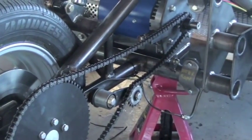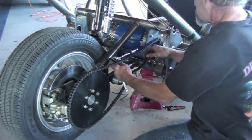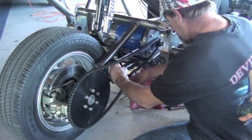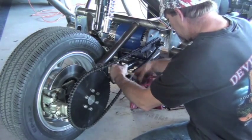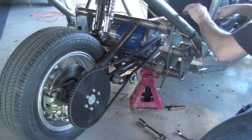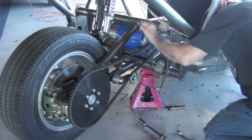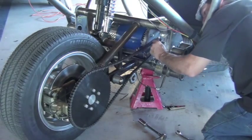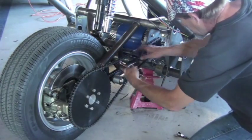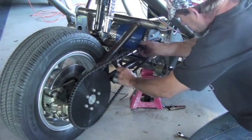We have our chain lined up correctly and our subassembly attached to the swing arm. Now we need to adjust the tension of the chain. We do this with a tensioner bolt near the motor — it pushes the motor forward away from the drive sprocket and puts tension into the chain. If you've tightened the bolts from the motor to the subassembly a little too tightly, you may need to loosen them slightly at this point. The chain tension bolt has a lock-down nut — make sure that's loose enough so the bolt has travel to move the motor away from the rear wheel.